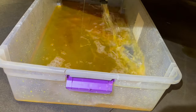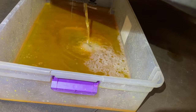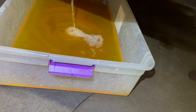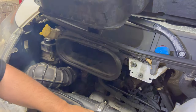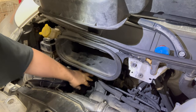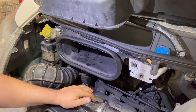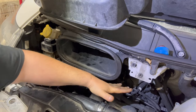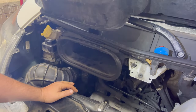Once that's mostly out, I'll put the hose back and cinch up the clamp. I've done this a bazillion times, so I'm going to leave the air intake bottle in place. What I'm going to take out is the fresh air intake tube — the plastic part of the intake elbow. Leaving the bottle in means when the intake comes out and goes back in, it has to do this Millennium Falcon thing where it rotates and comes out in a special way. We'll go through it together.